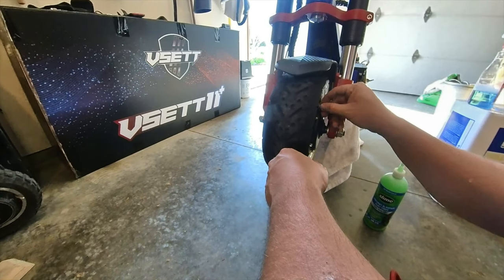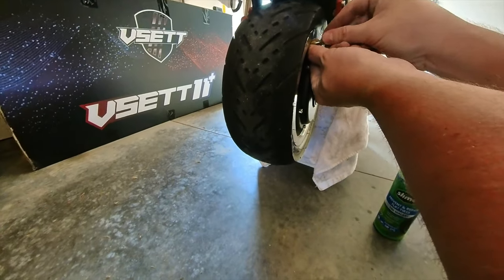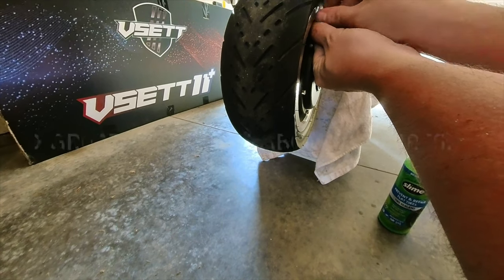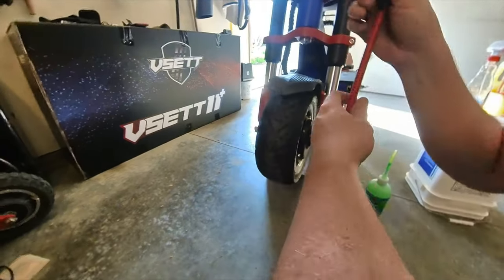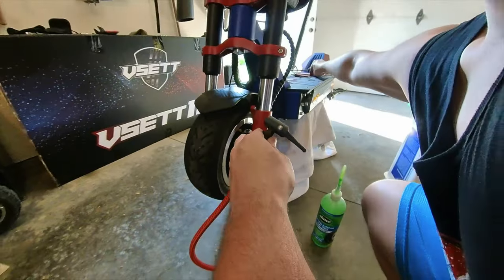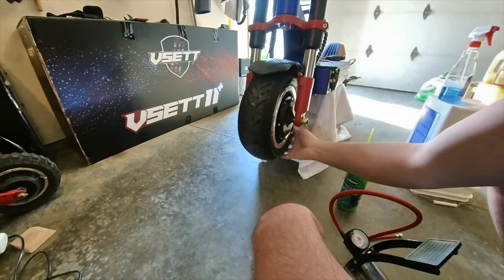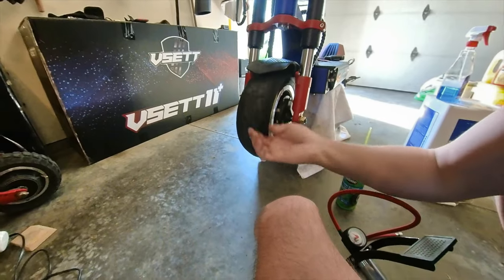Put the valve stem back in, get your tool, screw it back in. I'm in no way sponsored by Slime, I just like the product. It can be hard to get it on when there's no air. You might need an extender. So I typically like to blow it up halfway, spin it a bunch of times so that all the slime moves around, and then we're gonna blow it up the rest of the way.